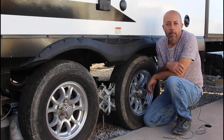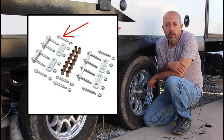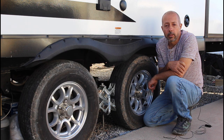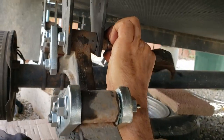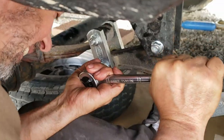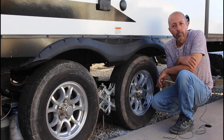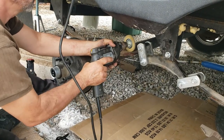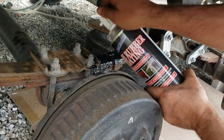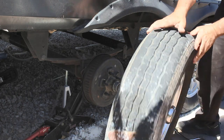The wet bolts come in two configurations: pairs come pressed into the shackle plates, while singles must be pressed in by you — it takes some effort to seat the splines fully into the trailer's frame. Wet bolts installed on the frame hangers should be pounded in using a pipe coupling to protect the zerk, then the nut can be torqued to 40 pound-feet. With the wheels removed, this is also a good time to grease the wheel bearings. I also wire-brushed areas where rust was forming and sprayed some rubberized undercoating before reinstalling the wheels and removing the RV from the jack stands.